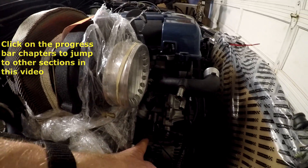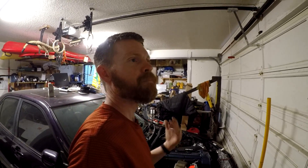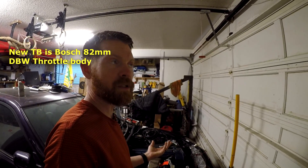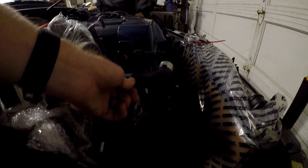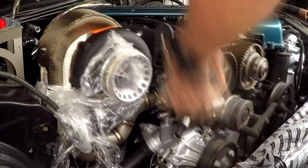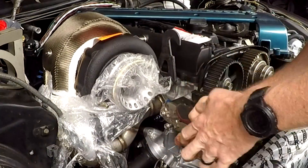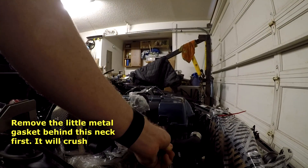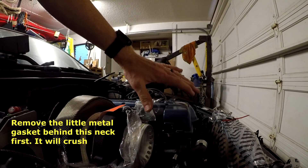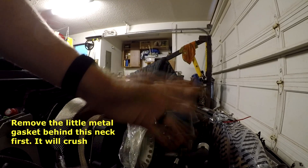I'm going to use the little port down there that comes directly off the water pump, because that used to go to the throttle body and my throttle body doesn't have liquid cooling on it. What I'm doing today is pulling these coolant nipples out — basically just clamping on, wiggling until they come off while it's still bolted into the engine.